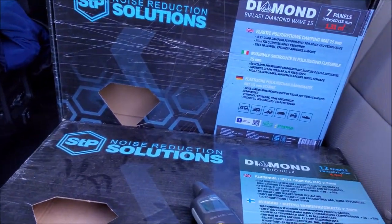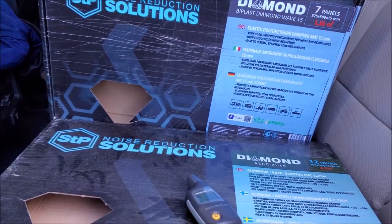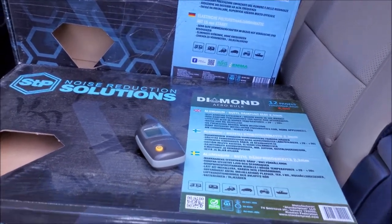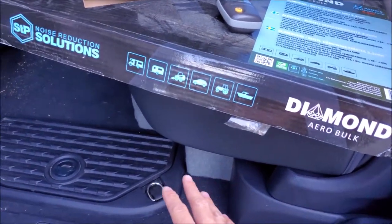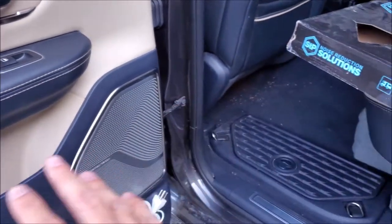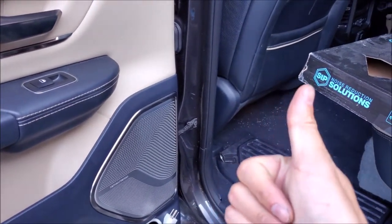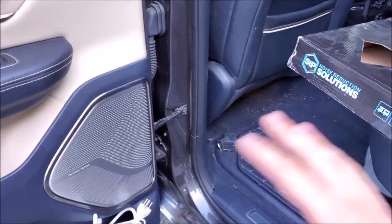We've done the doors, built them up, done the floor, and added a bunch to the back wall for sound cancellation. If you have aftermarket exhaust or loud tires, you definitely have to do the floor — that's where most of your road noise comes from with those lower bass tones. Stopping incoming noise from other cars helps immensely and really helps the sound system too. When you do something like this with STP Canada products, you're going to realize you're hearing more music, it's way more quiet, the music sounds better, and your whole vehicle just feels tighter when everything's done.